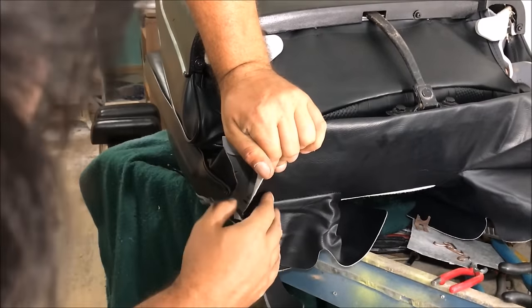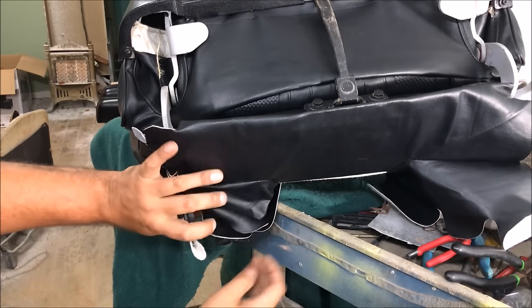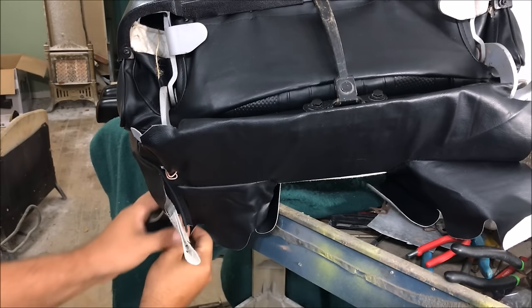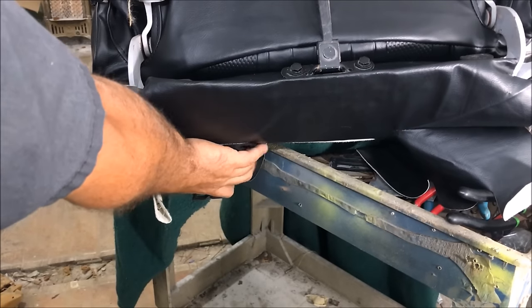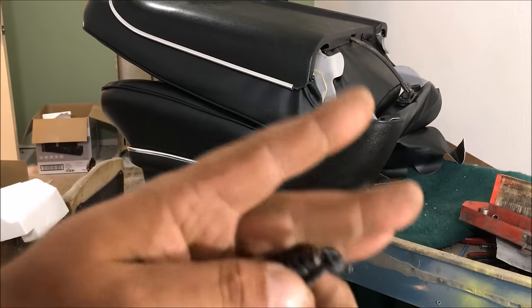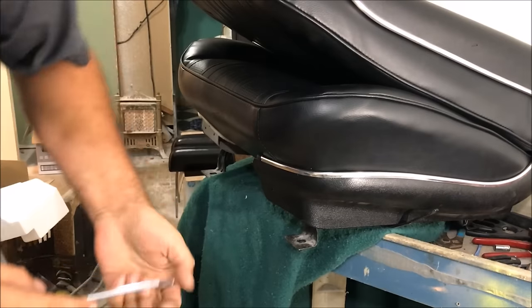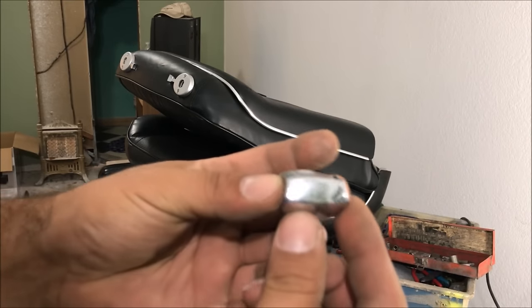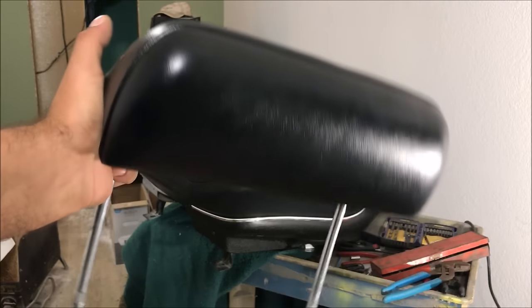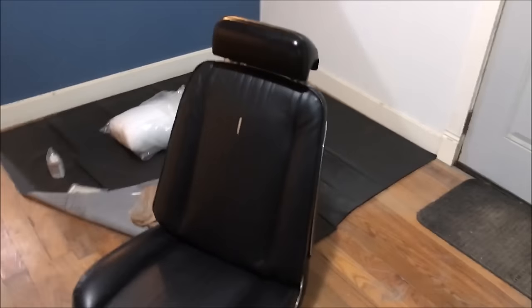With the tracks on, anything showing needs to be pulled out neatly. Stretch the panel straight, hog ring it on each side, then pull the other side and hog ring that too. The side panels are simple — just pulling and stretching to flatten them out. These hook over — using three screws, one right here and two in the front. These are original chrome handles I saved and touched up with silver paint. Original headrests cleaned with bleach soap and painted with vinyl dye paint.